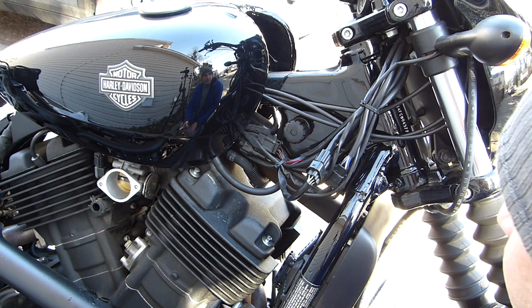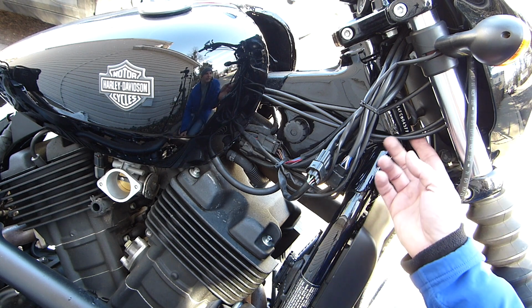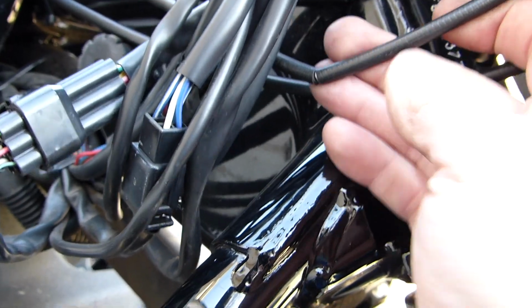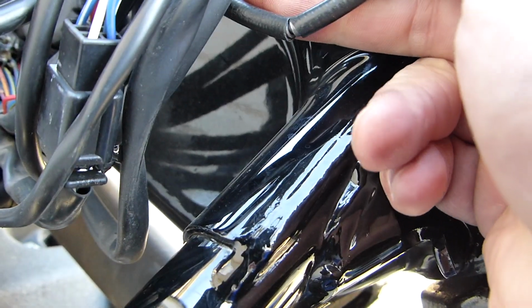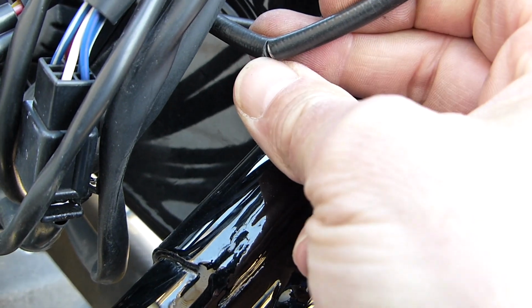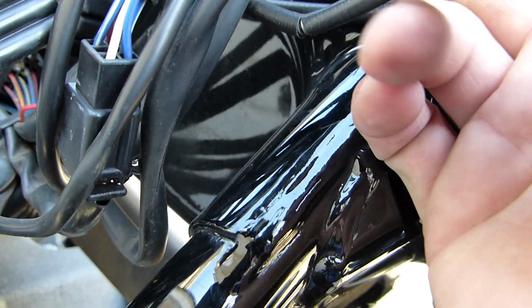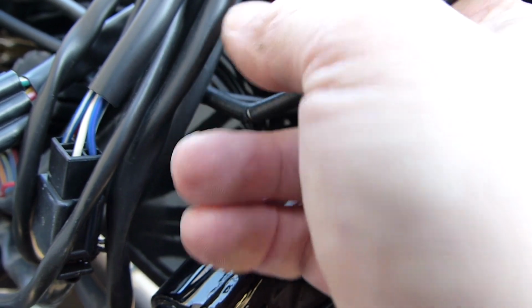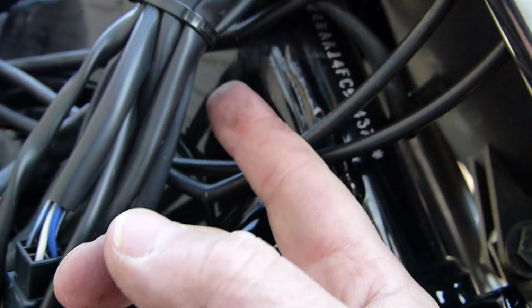So what I'm gonna try to do is cut the old cable, the sheath. So I think I found where it split. The insulation split. There's a hard bend on here. This must be exactly where the cable had just snapped. And this is a little scary because it looks like the throttle cable has that same bend. So I'm gonna have to order a replacement as well and install that.